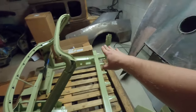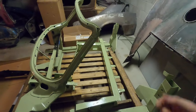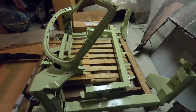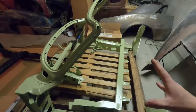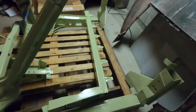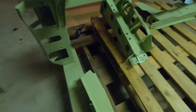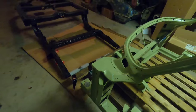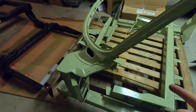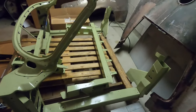For coupes they don't reproduce any of the roof structure, so if that's all rotted out and your car is from near the ocean, you're going to be finding nice used pieces or you're going to have to start hand-making stuff. Pretty much the only thing you can see when the whole car is together is the z-bar, and you can get a little bit of access to the joint in here. If you take the kick panels out you get a little access in here too. When the doors are open you can get a little peek, but you're going to have to be creative — maybe bring a borescope — to figure out the overall health of the car.